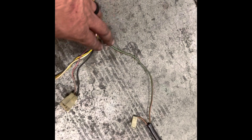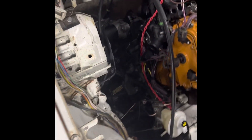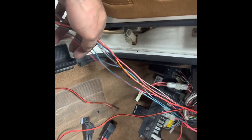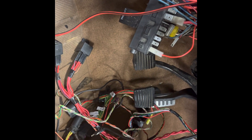This car's got a little front fog light on it. I'm going to grab one of these AC wires that I know goes inside and is easy to identify — that's going to be my trigger wire for that little fog light. We pulled inside our gauge wires: coolant temp, oil pressure. We've also pulled inside our reverse lights and our brake switch lights. We're also going to take this starter wire and run it back through actually with my engine wiring so that I don't have a single wire just running from my starter.